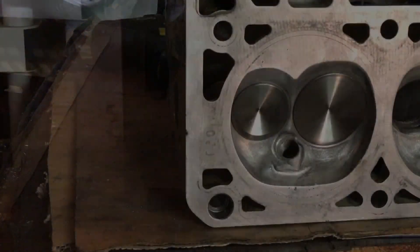I'm going to let this set for 5-10 minutes or so and make sure it doesn't leak. Let's stick the flashlight down the port and see if we have any light protruding. And again, we have absolutely no light coming around that intake valve. So now we'll move on to doing the fluid test.